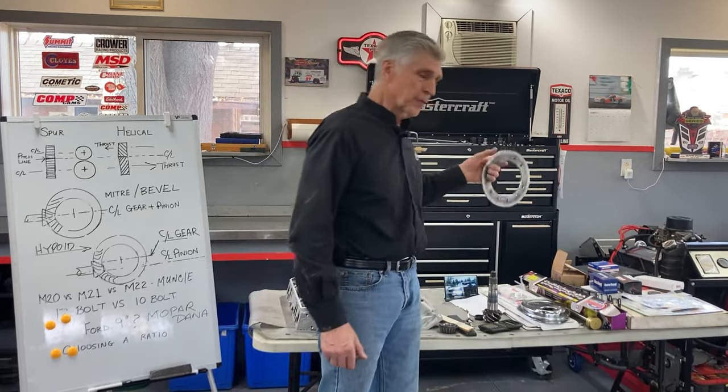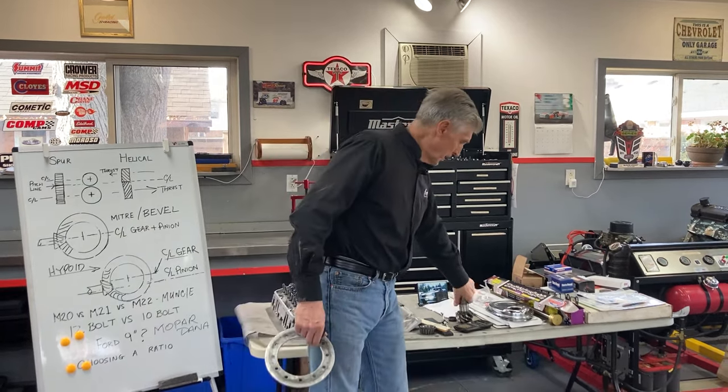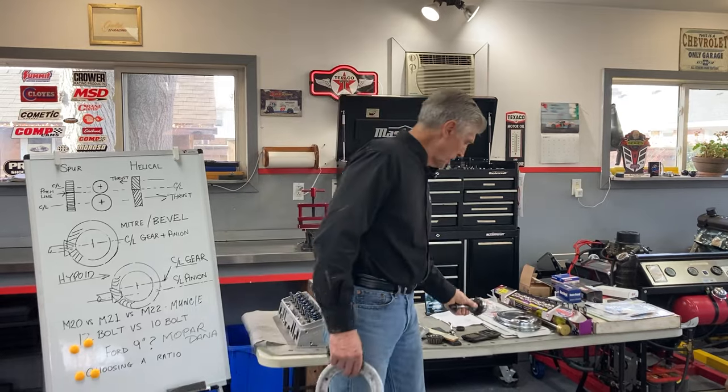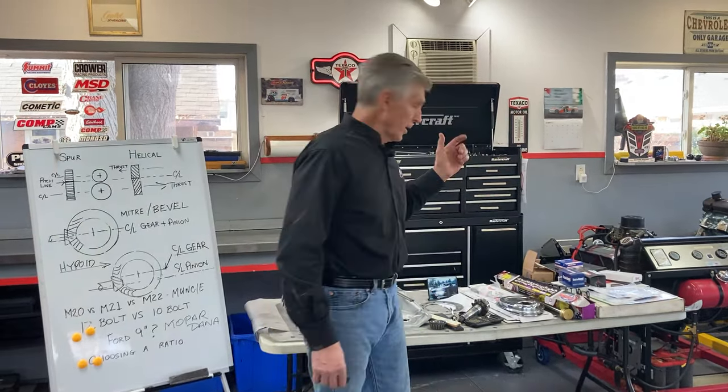One thing I forgot to mention during gearing: when doing a rear end swap on a GM, there's a 3-series carrier and a 4-series carrier. If your gear ratio is in the threes, you have one carrier. As the gear ratio gets numerically higher — like a 4.88 — the pinion gets smaller and moves farther from the gear. The right fix is to buy a 4-series carrier, but back in 1969 we never did that. We would use the same carrier with a Mr. Gasket spacer — the one that came out of my 4.88 rear end when I took it apart around 2015 after putting it in in 1969. It worked just fine and never failed. That's how we made up for differences in carriers.